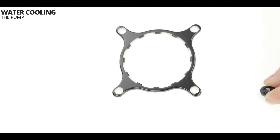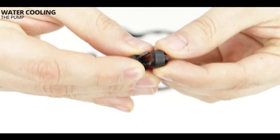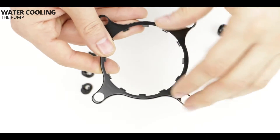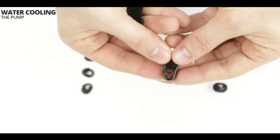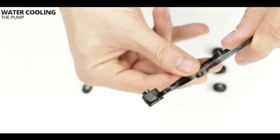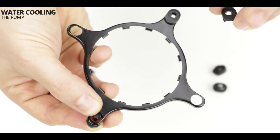For the pump bracket, a little assembling is necessary. Make sure to have the male and female adapters lined up and aligned in the right orientation as shown in the video — they allow you to easily switch between LGA 1151 and LGA 2011 sockets. Facing the holes of your bracket, you should see three pyramids; the largest one should be based towards the inner circle of the bracket. Repeat this operation three more times. The plastic elements tend to be fragile and can break, so go slow and align them as shown on screen.